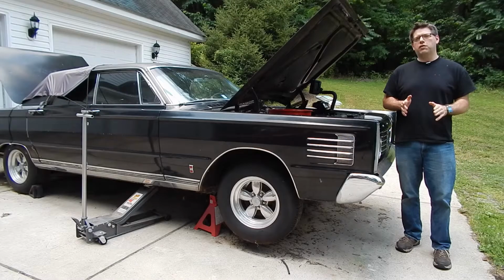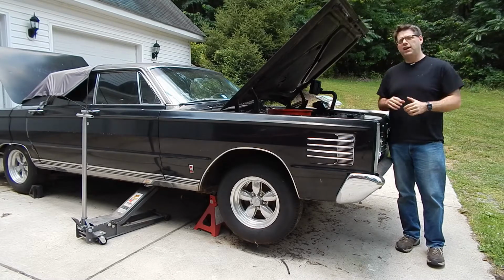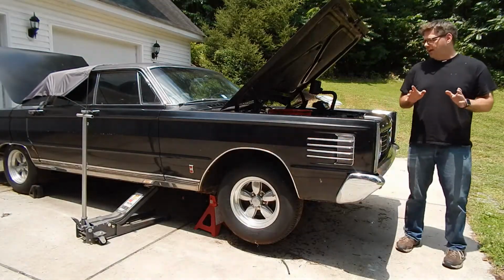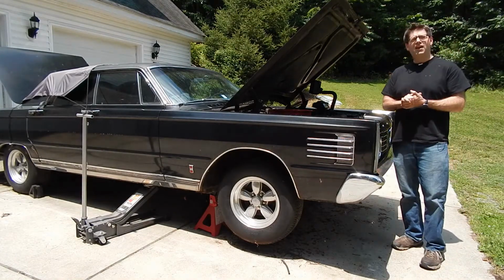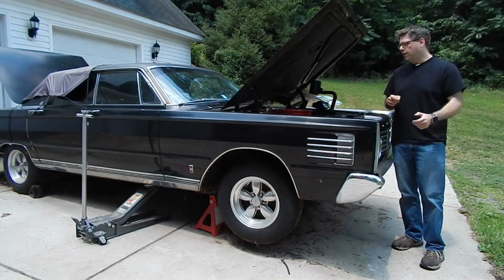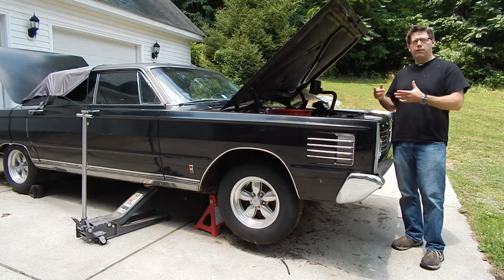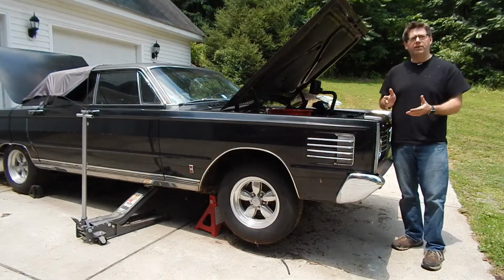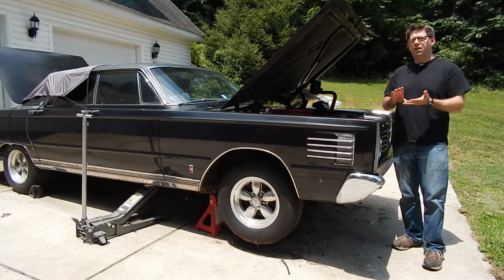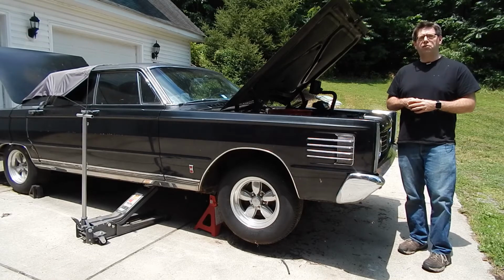Hey, so we're going to cut in here really quick. I'm probably going to splice this right into that video we were shooting this morning. We've got a little bit better shading right now, so we can actually see that piece a little more. And I did a little bit of checking on the internet, and I think I know what that is. I believe that is a coolant preheater that you would have a 110 volt plug for and plug into your house current, and let that run overnight. I guess it's probably a pump and a preheater, so it would circulate that coolant and keep it warm. The whole idea is that in some of the northern climates, if you get freezing that goes below what your antifreeze can handle, it keeps it from freezing and cracking the block, but also probably gives you a jump in the morning with slightly warmer coolant, and lets it get up to temperature a little faster.